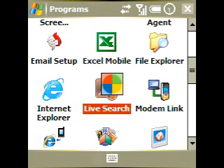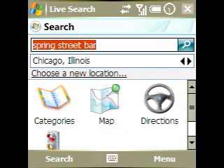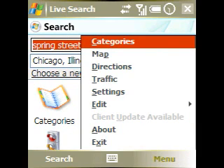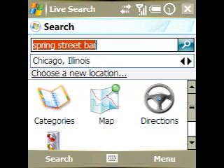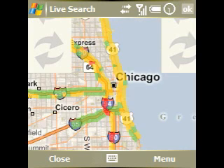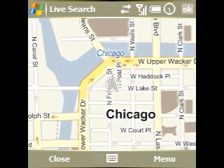Live Search from Windows is also aware of the GPS, although strangely it's not as automatic as Google Maps. Inside Live Search, go into Menu, then Settings, and you need to choose a COM port. I chose COM 5 — the program port we set up in the last step. You could also choose a hardware port, it doesn't really matter. I don't have a satellite signal here where I'm working, but if I did it would work. You can click the Menu button, click Center on GPS, and use it in Windows Live to find directions from your current location.